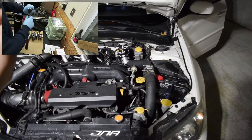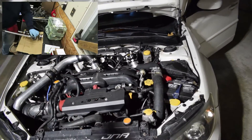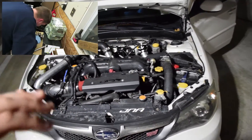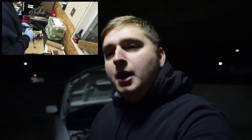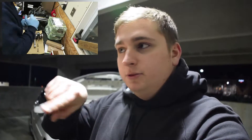The heads are pretty much stock except for the Manley valve springs. I didn't want to go crazy because these heads were kind of messed up after the motor got the rod knock. The material went through the head, and there was so much material that went through the motor that — after running it, because I drove it home, which was a terrible mistake, never do that, just call a tow truck — I drove it home from where I blew it up, and that caused a lot more damage in the heads. Right where the cams ride is a journal, there's no bearing on the cams, so it's just a metal rod riding on an aluminum head.